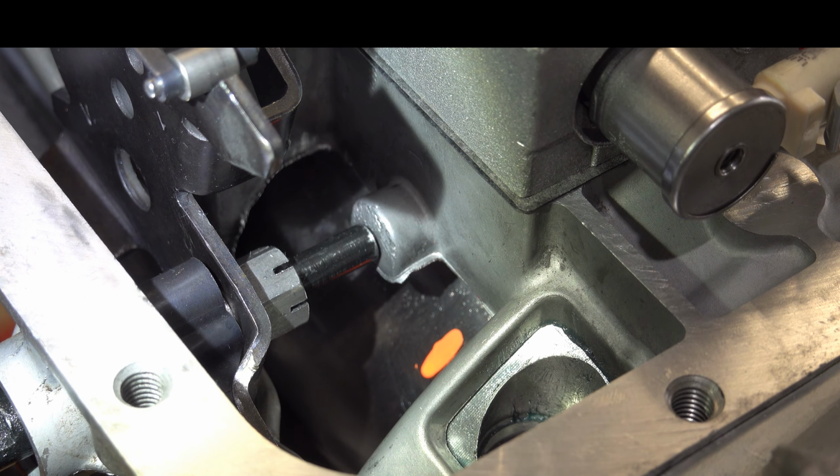Same 31, 32 thousandths. I know there's a little bit of variance with those three measurements, but I'm comfortable saying that 30 thou, 31 thou is where we're at, which is a little on the tight side. I figured we'd be tight. The likelihood of us being spot on was minimal, just given what I know about these things. So let's go ahead and move the camera.